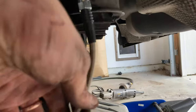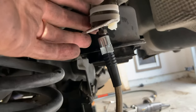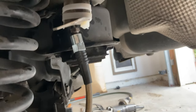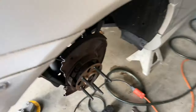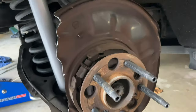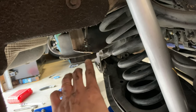The Stoptech lines were just a tad bit short with these calipers. We could have gotten them in probably, but it would have been a little tense when hanging all the way. So we just zip tied them to the brackets — the hard line is zip tied to the bracket itself so it's not going anywhere. I just didn't want to wait and order longer lines or something. These are usable, so it works. Here's the other side — just cut the brake dust shield off and use a hammer to bend it back so it's not in the way of the rotor.